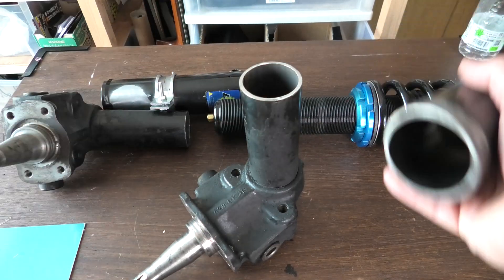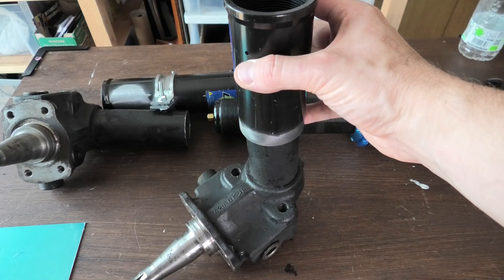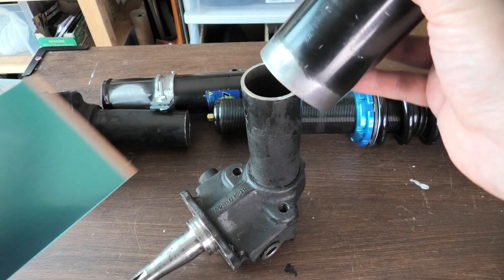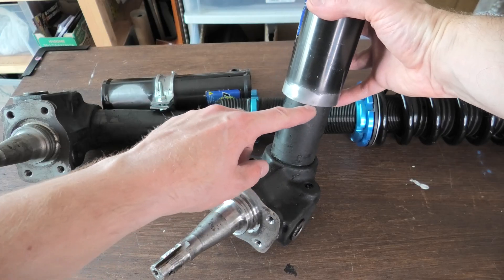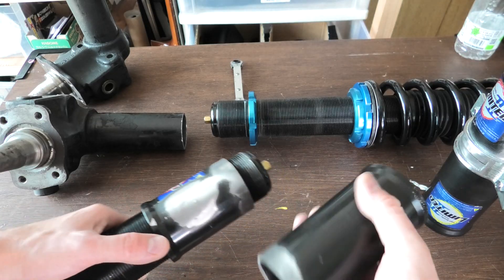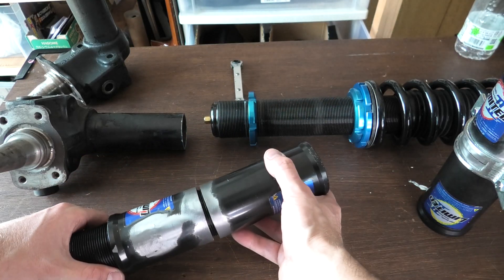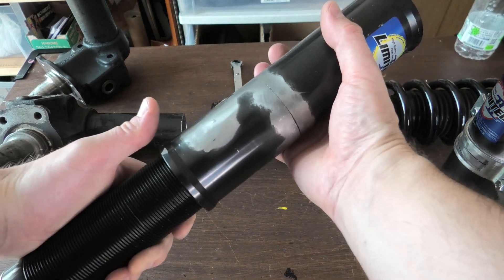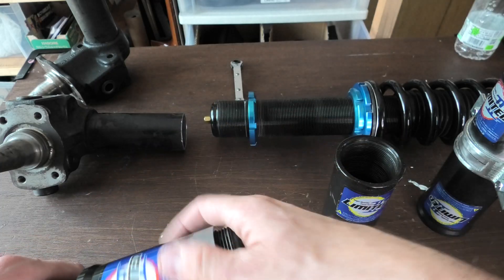A bit of progress — I've cut those off, and the plan was to put one over the other going down 40 to 50 mil and weld it in position. But the internal diameter is a bit too loose, so I bought some copper sheet to make a shim. Then I thought I don't like the idea of the whole weight of the car sitting on a weld, so instead I'm using two tubes end to end — the short one first so the weld lines up with the solid part of the tube. I'm prepared for a welder to say they won't do it if the metal gets too hot.